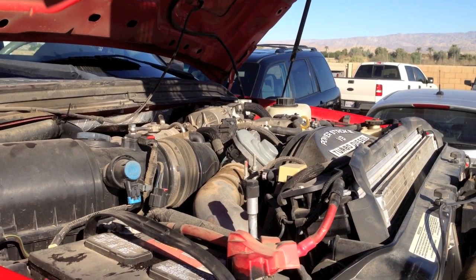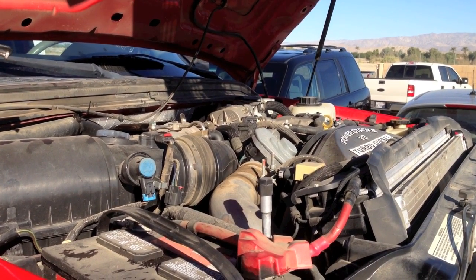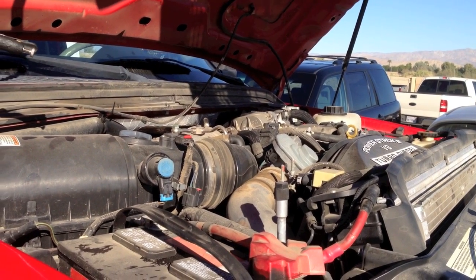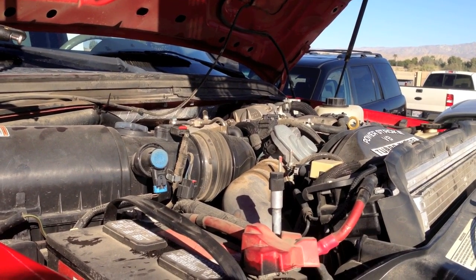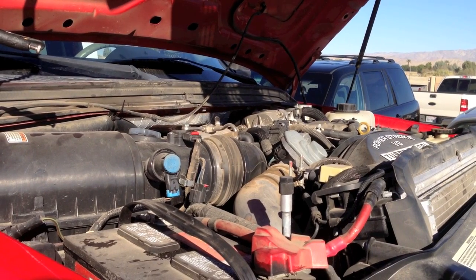Today we've got a 2008 F-250 6.4. It's got a popping through the intake. Truck has about 81,000 miles on it, and we're seeing about 3 or 4 a year coming in this way. And what everyone has in common is lack of maintenance and overfilled on oil.